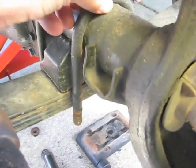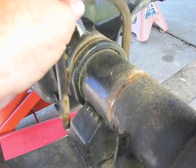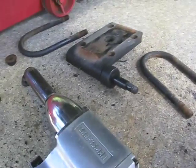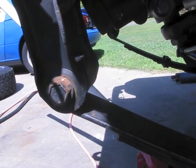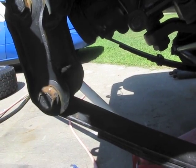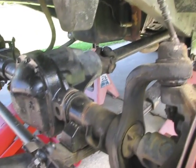The spring plate is removed and now I'll go ahead and pull the U-bolts off. I'm going to remove the brake caliper and strap it up to the shock mount for right now since I'm not doing the brake line extensions just yet — I'll work on that later. This leaf spring is now ready to be removed, and using the impact wrench it'll pull the bolt right out as I back off with it.